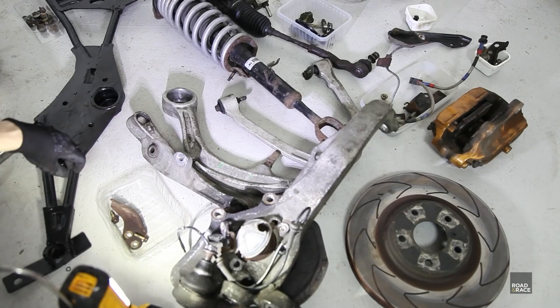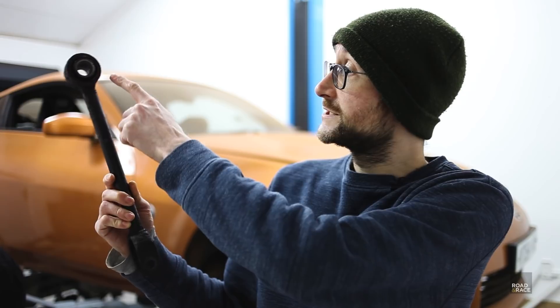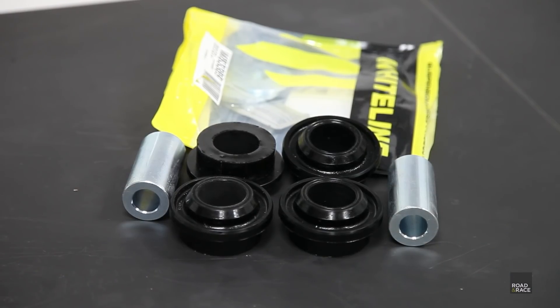So that brings me to what's next in this series. Whilst it's primarily about treating the rust on the 350Z, if it makes sense to do a few cheeky upgrades whilst the car is in pieces, then why not? Since the suspension is in pieces, now is the ideal time to replace all the worn bushings and upgrade them to stiffer poly bushes. The stock rubber bushings are fairly flexible — good for daily driving comfort — but this car is more of a track day car, so I'm going to fit polyurethane bushings, which should give a firmer ride, less body roll and more grip on track.